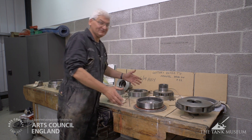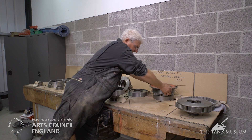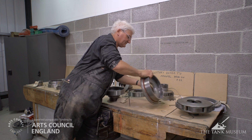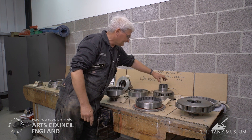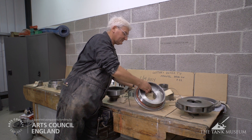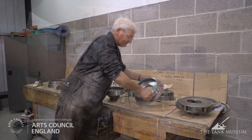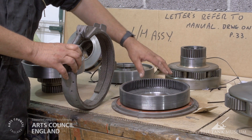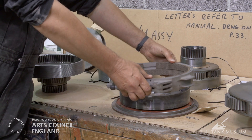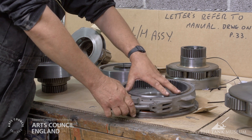Basically all of these gears — it's a little bit difficult to show at the moment — but a component slips on top of another like so. Those teeth there are engaging on these planetary gears. These can be driven either way: either by the planetary driving the sun or vice versa. They're actually engaged inside the gearbox by a brake band which operates on the outside edge. You'll notice the grooving that increases the area for the braking material. There is a brake band assembly with friction material that fits around the outside of the drum, and that pulls together using very strong springs, gripping the outside of the drum and engaging the gear.